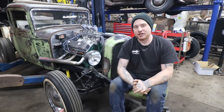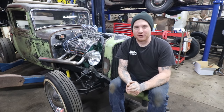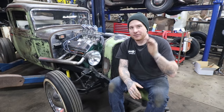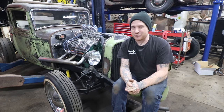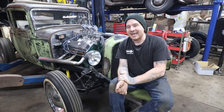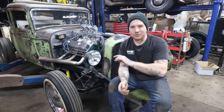The big boys in the first generation of Oldsmobile V8 engines are the 371 and 394 Olds engines, and most commonly thrown around is the term J2. This is when the famous Olds J2 engine came out with the 371s — that was a factory higher-compression, 3x2 carburetor setup. It was a kind of expensive option you could get, and that was the hot rodder's choice. Pretty much all of the big stories, the folklore of the day — every guy's hot rod had a J2 in it, whether it actually did or not. Everything had a J2 back in the day, and in all the magazines you read it's Olds J2.